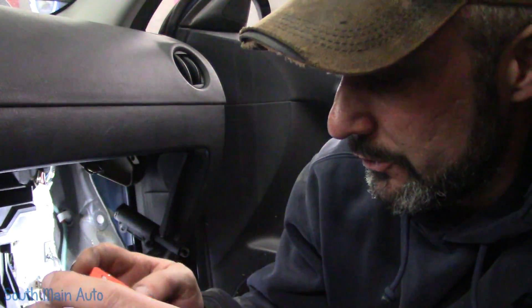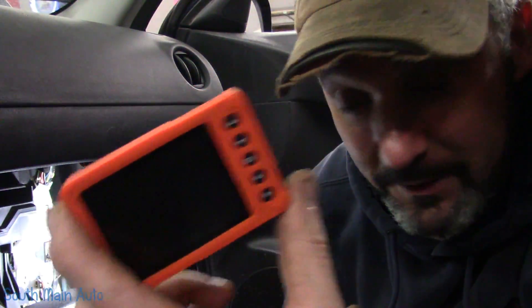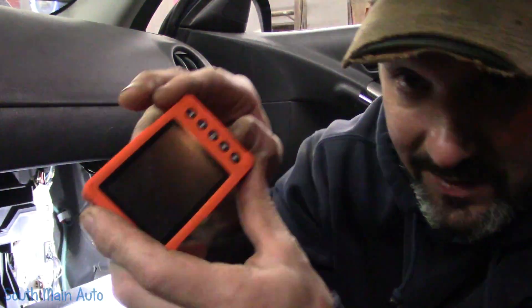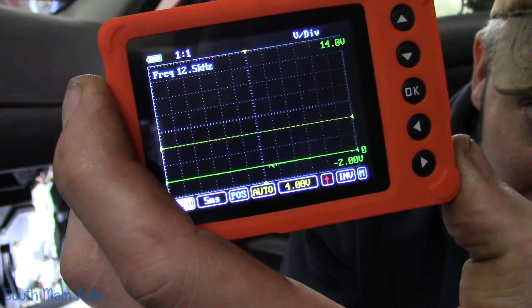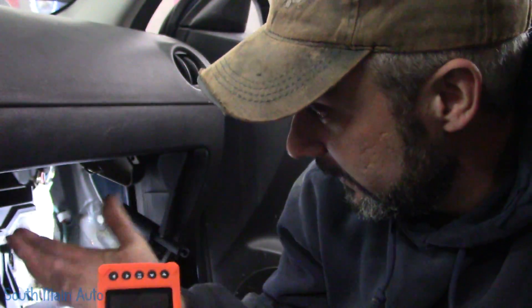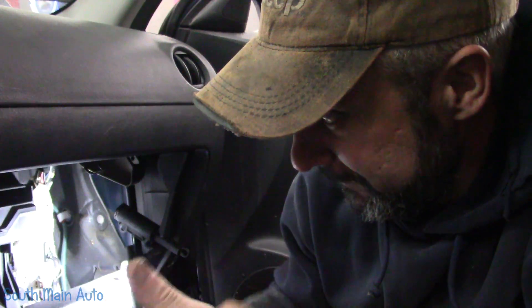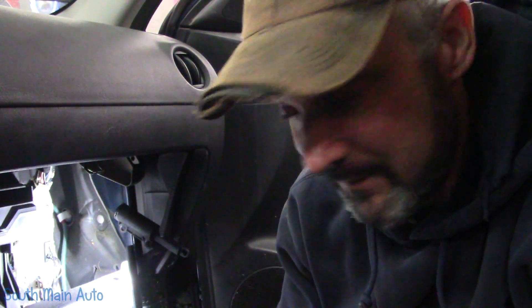One thing I will mention about it — not trying to be a U-scope salesman — is what's pretty cool is, first of all, I don't have to drag out the Pico, which is a fantastic tool, better than this. But I've got to get out the laptop, the scope, the cables. With this, I flick the switch on, count to maybe five or six, it's booted up and ready to go. And it's this big. You can use it for little tests like this — is that motor bad? Grab your amp clamp, throw it on, and you're done. This is completely non-invasive. You're in, you're out, you order the part, and you can 100% confidently say the blower motor is failing. And that's all there is to it.